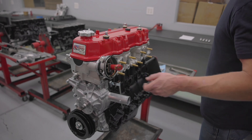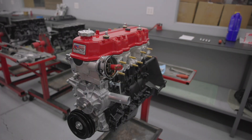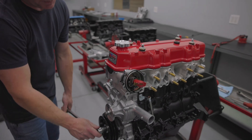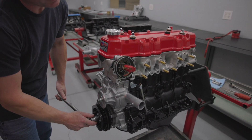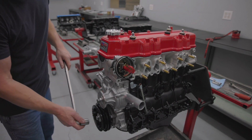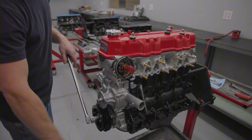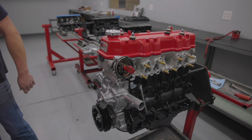So we got our distributor cap off. Now what you're going to want to do is get this turned to basically where it looks like it was pointed at right where the wire was coming out of the cap. And then when it's pointed there, you should have your dot on the crankshaft lined right up with your zero. Now you can be 180 out where this dot will still line up on the crank with the zero, but you'll have your rotor pointing 180 out. So you've got to make sure that you've got this pointed at one and your mark at zero.